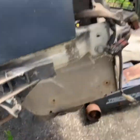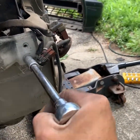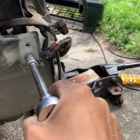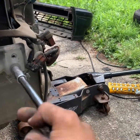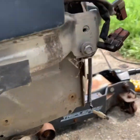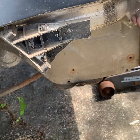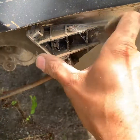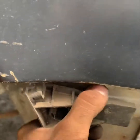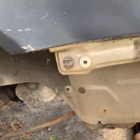To take out the fender, you have to take out this screw right here. That's the reason you want to take off the bumper — to get to this screw right here. Once that's out, there's another one right here. This one just slides out. Try not to break it, because you need it to put the bumper back on.